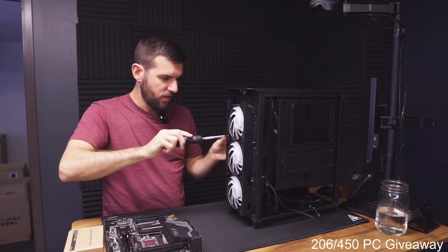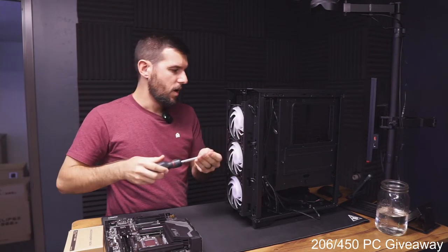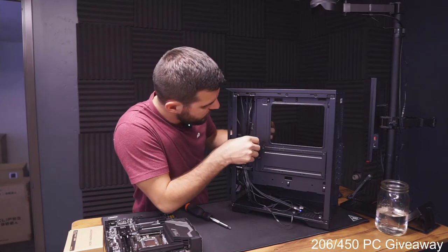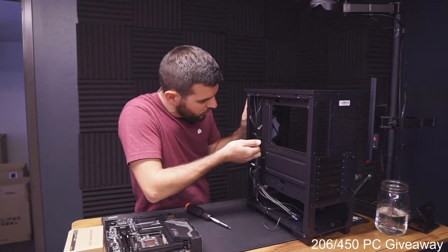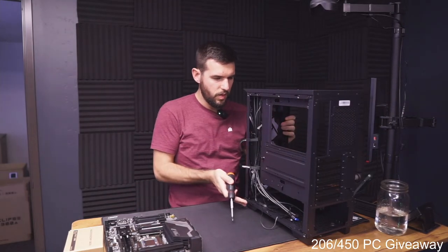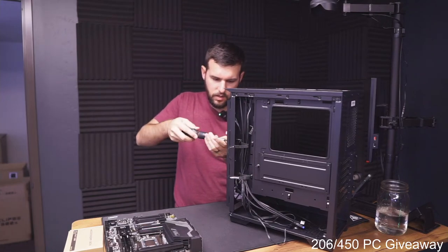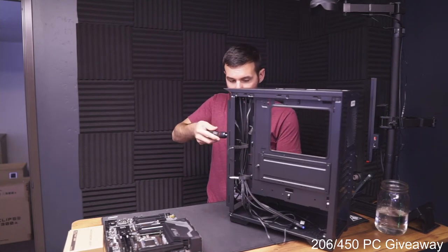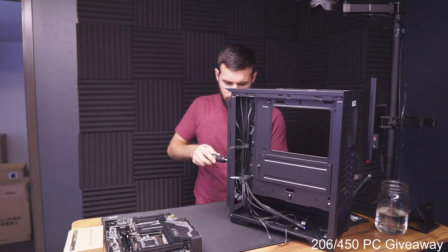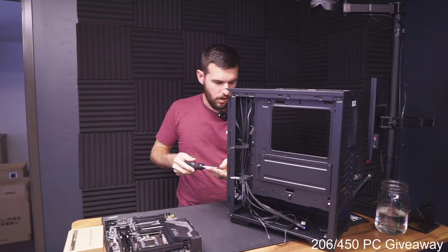So, RK, you'll find this interesting, at least. I wanted to see what difference it makes in some benchmarks with lower end RAM and some higher end RAM. So I took one of the first kits that was released for DDR5. It's a CL40 5200 megahertz kit from Team Group, and I did the XMP for it, and then did some CPU tests, GPU tests, and then a couple of in-game benchmarks. And then compared that to a CL30 6000 kit. And then compared both of those to a CL32 6400 kit. And they're basically almost all exactly the same. There's almost no discernible difference when they're not tuned at all.